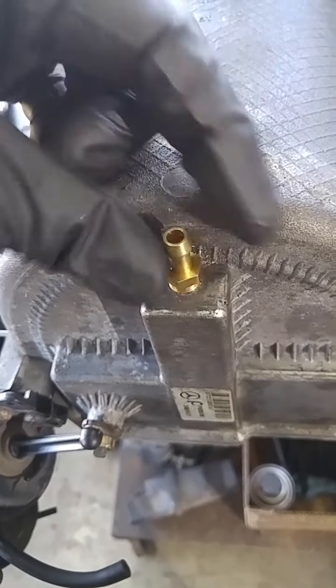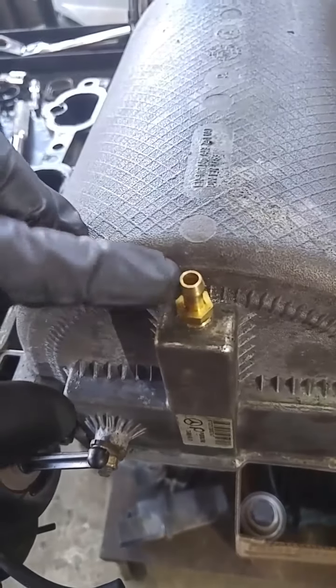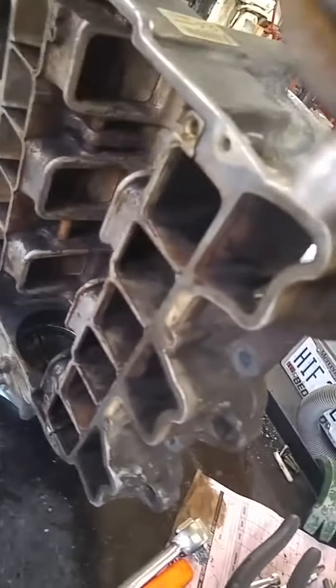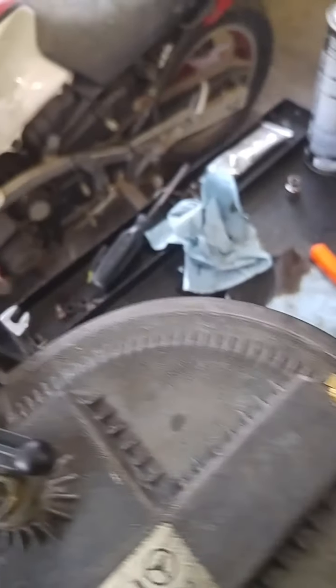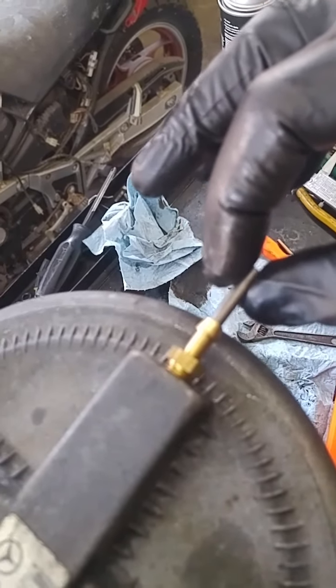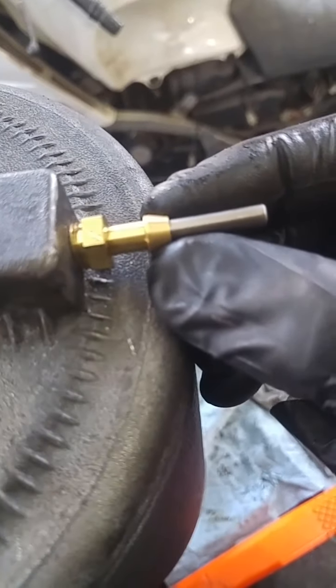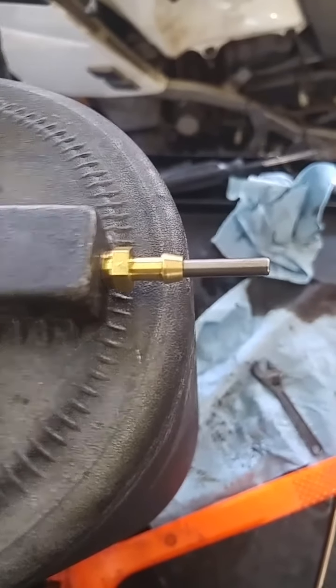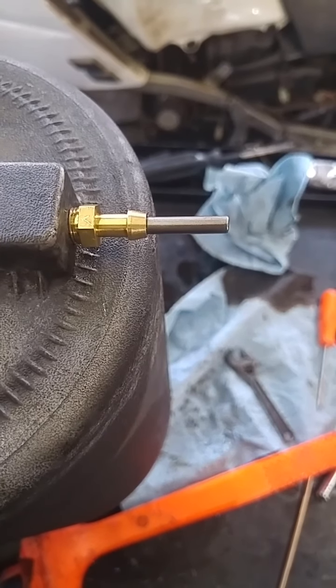This is going to screw into there. And I'm actually going to solder a piece of steel brake line through this nipple. Put the insert back inside. The grommet is not in there right now. So that's up against inside there, and I want to pull it back an 1/8 of an inch. There's no reason for it to be too close. If it's too close, then the insert won't screw in properly. So I would say you want to leave yourself at least a good 1/8 inch. And then solder that little guy.